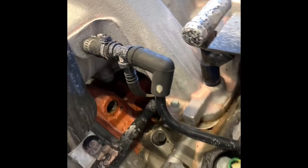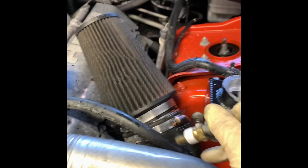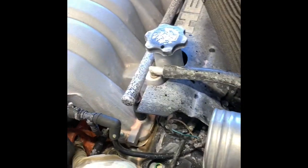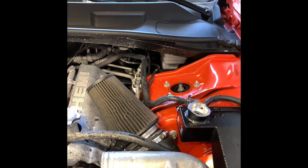So what I've done is take this pipe off here, and right underneath the throttle body here is the port where the coolant temp sensor goes. I've removed the coolant temp sensor — now I can fill the coolant up until it pours out of that hole where the temp sensor was located.